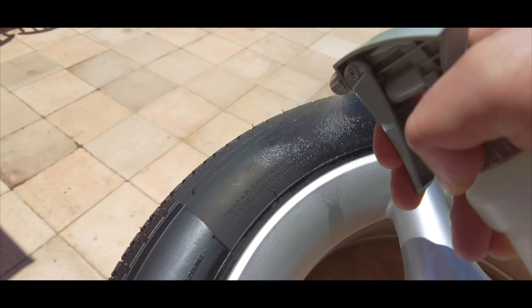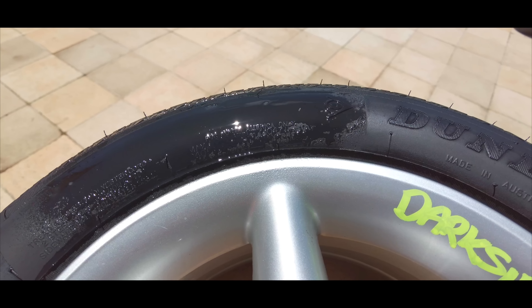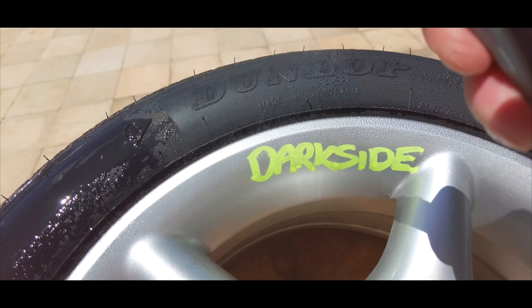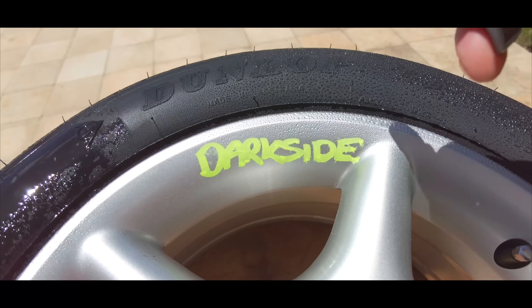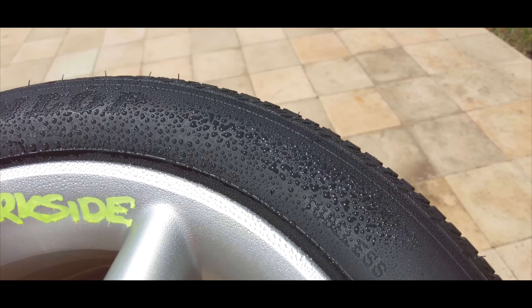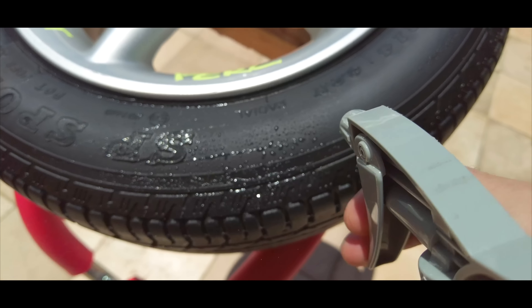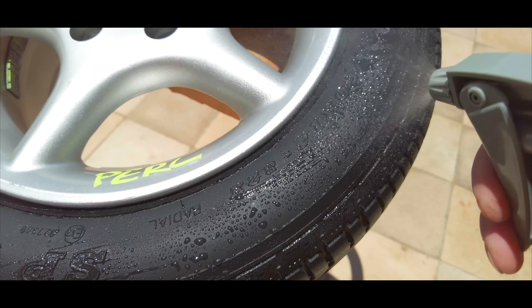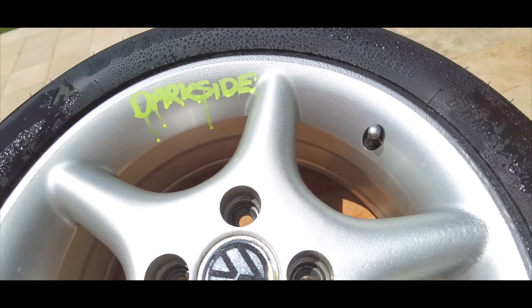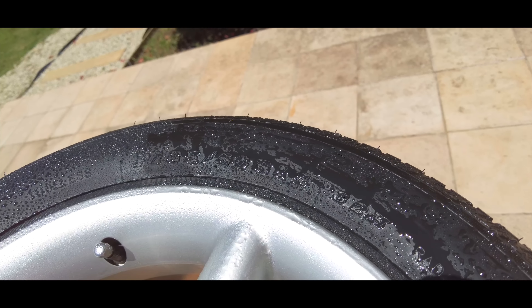Next up was having a look at some water behaviour. I'm not sure if I'm all that concerned about hydrophobic behaviour on tyre walls, but if it also helps with a little self-cleaning and dirt repellency, that's a great bonus. Going back to the shots with the white Corolla, it was clearly evident that the front tyres with Darkside looked way cleaner than the rears with Pearl, but that's also partly because Pearl had since diminished. It was also evident that the tyres on my Alfa look pretty clean since I applied Darkside. Darkside is in fact quite a hydrophobic tyre sealant with quick water sheeting and dramatic water bead contact angles. Contrast that with Pearl — although it's still hydrophobic, Pearl certainly isn't in the same league as Darkside, at least on this tyre.